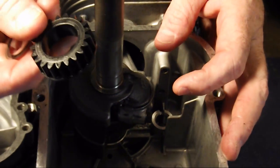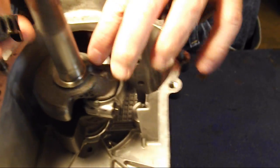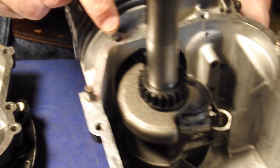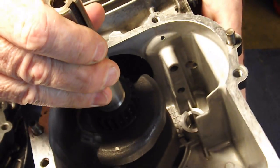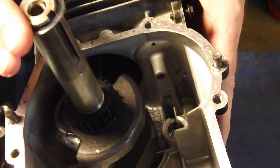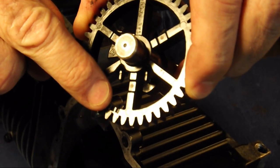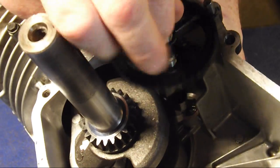Then you would take your crankshaft and install it straight down and it would go on like so. Then our crankshaft gear will slide down with this going into here, just like so. And then there's a timing mark — it's a little tooth right there — and by the way this washer goes right here. There's a timing mark right here on our camshaft and we want that to match our crankshaft gear right there. You see that mark? And that will fit in right like so.